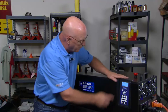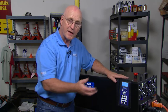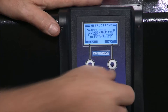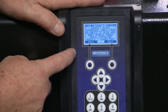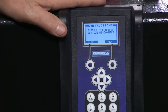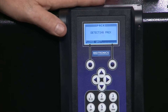We're going to do a discharge with a target voltage of 280 volts — I simply hit next. At this point the software tells you how to make the connections. To save time, we made the connections in advance, so we'll go through and see what the screen says and continue with the prompts. This connects at the inverter, then the black cable to low voltage through the VIM, the vehicle interface module, then install the manual service disconnect. We hit next and it's detecting the pack.